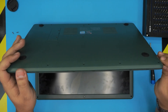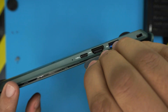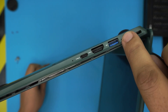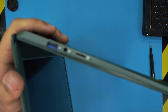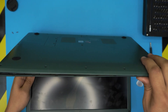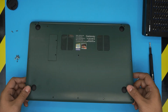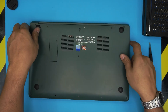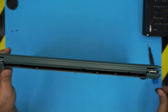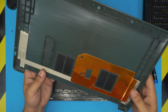Go all around the front edge and do the same thing on the sides, all the way to the back corners. Just work your way around — you don't have to go all the way back if it's not going; don't force it. Once the front and sides are loosened up, grab from the front end of the laptop and lift it up, wiggling to release the clips on the back end. If the back is still stiff, stick the guitar pick at the back and peel it off a little. Sometimes just lifting the front end causes the back clips to pop out on their own.